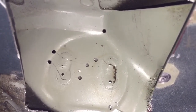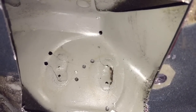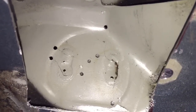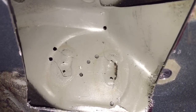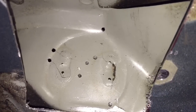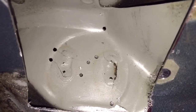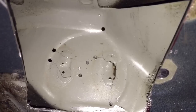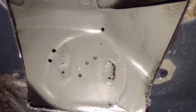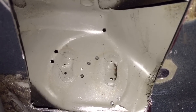And you imagine if you'd plated the car underneath and then carry on driving for years, thinking, yeah, my car's reinforced, got great plates underneath. Yeah, you've got this inside the cabin, festering away, probably progressing at a slower rate because of plates underneath, but still will progress. And then you're only going to have more problems in the future. So better to get it all out of the way whilst the axle and the fuel tank are out, take the interior out, do the job properly, and resolve all the cracks.